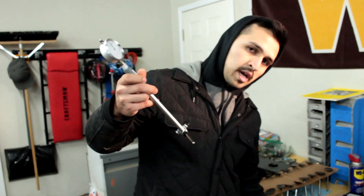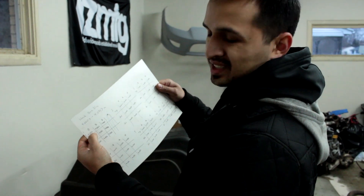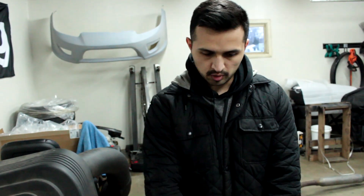We finished all of our measurements and our biggest diameter was four point zero zero one, so that's gonna be our piston size. We were thinking about honing to five over — point zero zero five — but we decided not to. We found some pistons that'll work, and we're gonna have a lower compression to run a decent amount of boost later on. That's pretty much it — thanks for watching.